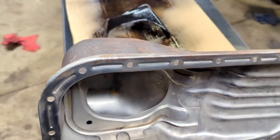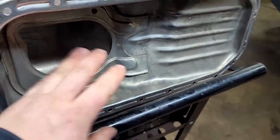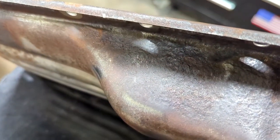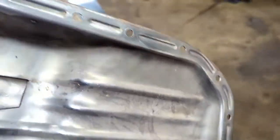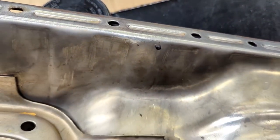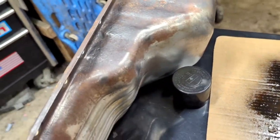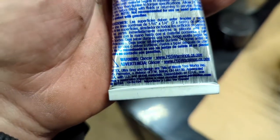Here's the oil pan from this car originally. When I rebuilt this engine about three years ago I cleaned it up and hot tanked it — super clean inside — then wire wheeled it. I was hitting a lot of hard rust over here and I poked a little hole. I ended up filling the whole lap with JB weld and you can see it filled in right there. I'm gonna do the same thing again but instead of JB weld I'll use RTV because I'm a sucker for pain. I'll lay another bead of Ultra Grey gasket maker — high torque. It doesn't really specify high temp, but who needs to read instructions, it'll be fine right?